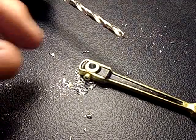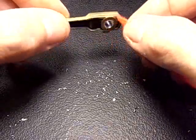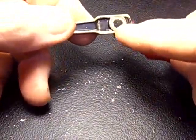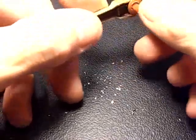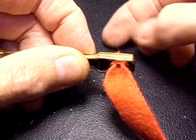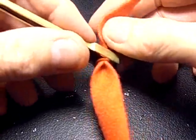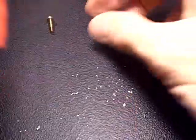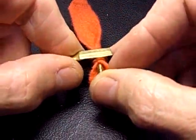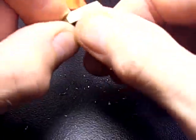There is nothing really wrong with zinc — it just does not make an ideal bearing metal, although it does work for bearings. I have drilled the hole out to the extent of a number 7 size drill. Here is a piece of bushing cloth. You rip it to a width equal to 3 times the diameter of the hole. This isn't rocket science and you don't have to be all that precise with the ripping width — it just gives you a nice joint. You point one end with scissors and then pull the cloth through. You see how the torn edges enter it — we won't have any seam at all. Just to get an idea if we are in the ballpark, you don't need a dial indicator or caliper; you can do this all by feel. If I can get the pen to shove in there at all, I'm in business — that is a good size, so we are going to stop here at number 7.